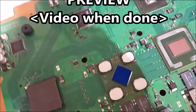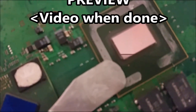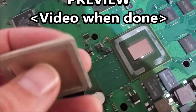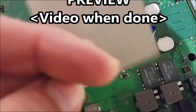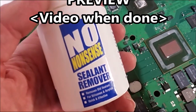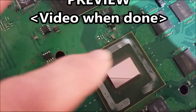I'll show you what a pallet knife is — it's one of these flat bladed ones which is kind of curled up at the end. What you have to do is slide it under and break the seal. When you actually take off the heat sink for the first time you'll see the heat paste is completely ruined. The graphics chip is slightly easier to get off — you just have to pop it off. I was also using super glue remover and no-nonsense sealant remover, which I think helps because it does kind of melt the silicon sealant but also gives you lubricant so it doesn't scratch the chips badly.